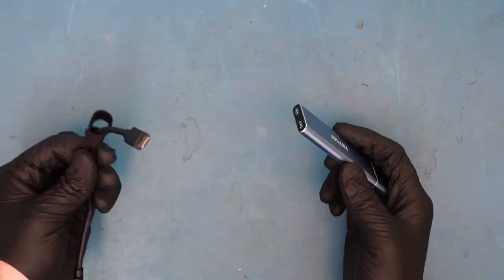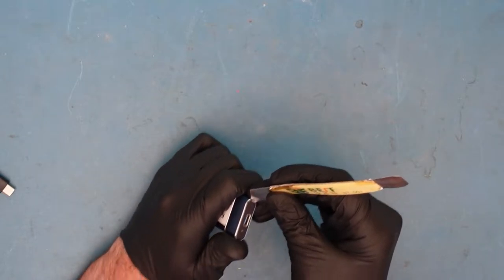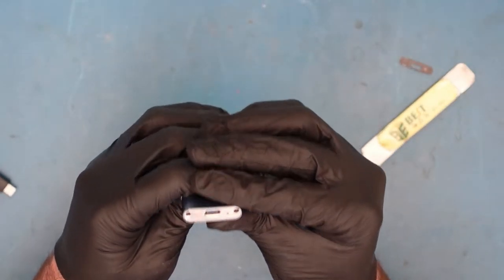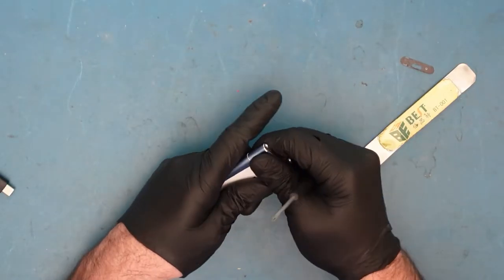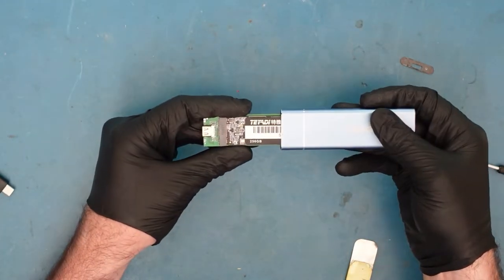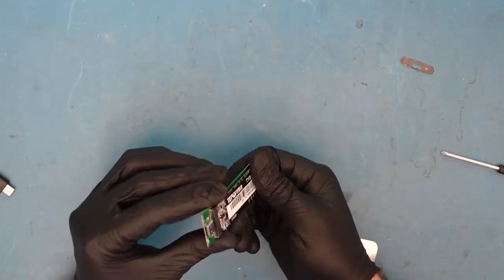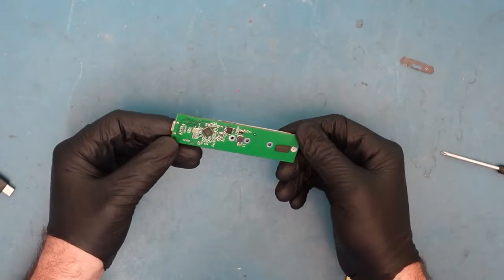These, especially if it's USB-C, are usually on some of the higher-end models or maybe like a MacBook, so we'll be prepared for that. Usually these have screws somewhere — you can take a little flat tool, there should be a little cover case that comes off. There's probably a screw or something. See, it easily just kind of came off just like the other one because they're all pretty much the same. So now we have two Phillips head screws. This is an enclosure so you can use it as USB-C. Let's go ahead and slide out the drive.